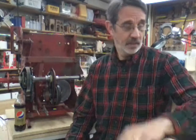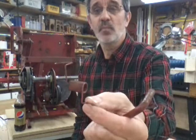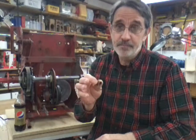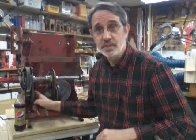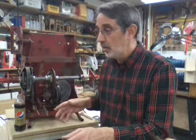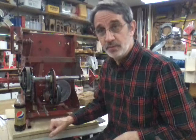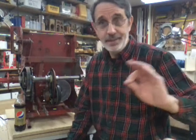Well, we're going to show you. The spring that you mentioned that's broken looks like this. What this does — it's probably one of those pain-in-the-butt parts that you don't really need. I would tell you to hook the rest of it up and see if it runs without this, because I'm pretty sure what this spring does is it's part of the reverse assembly. So when you're backing up your snapper and you push the clutch in a little bit to straighten out your trailer, or if you want to slow down, as soon as you touch your clutch, this thing pops into neutral and then you've got to try to get it in reverse again. That's part of the mechanism that hooks up to the reverse — and if that's the case, you don't need it.